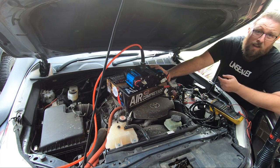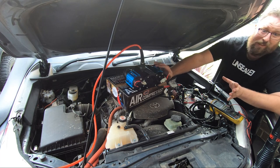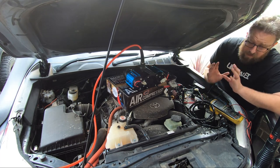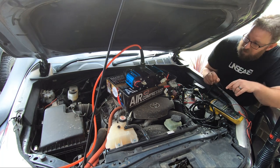End of the day, if you're going to run your compressor you absolutely must have your car running. Keep the volts really nice and high from your alternator, everyone's happy, and your compressor - or your winch, whatever electric motor you're running - will last a lot longer.